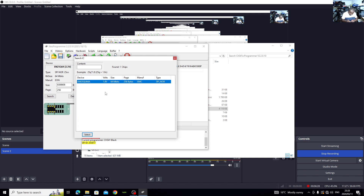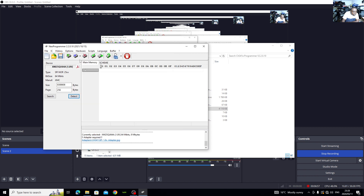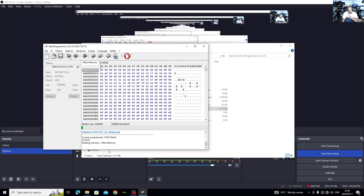If you get yourself a programmer, it will be easy for you to extract a file. I see no point asking someone how to extract that file when you need to get yourself a programmer. There are cheaper ones in the market that you can use. Let's first of all read the old file — I'm just going to make a backup of the old one, just in case.